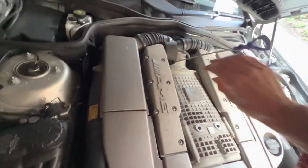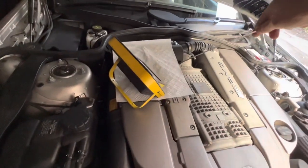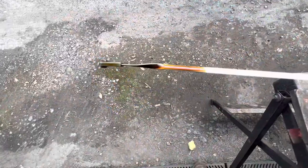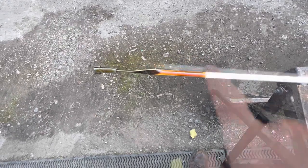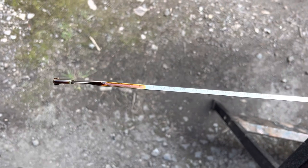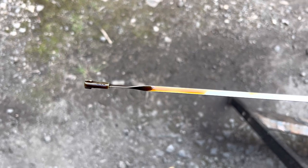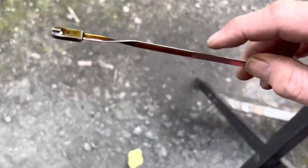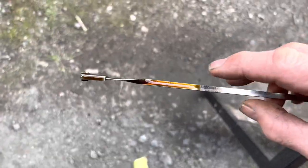The dipstick is not going to go in all the way — it goes in about this far. I already know we need to add about a litre of oil, so let's see what the dipstick reads. There we go — that's reading about 85 millimetres on the dipstick. Putting the graduated side towards the windscreen matters because on the other side you often get oil smeared all the way up as you're drawing it out, giving an inaccurate reading.